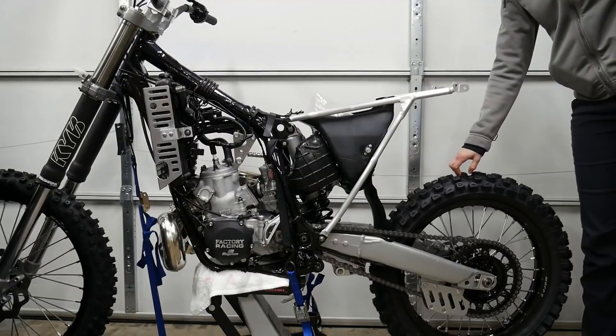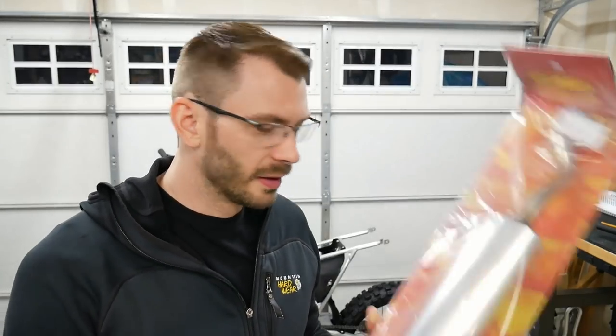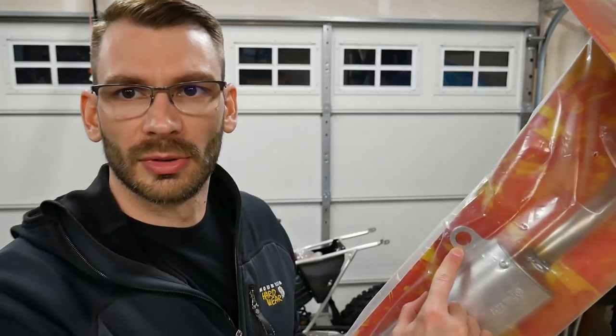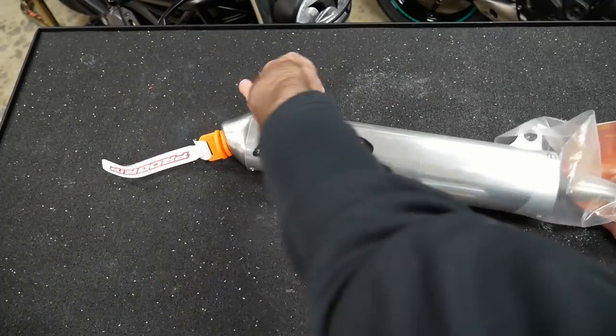So we went through all the gears and we confirmed that if the clutch had oil, it probably would have been a lot smoother. So next we're gonna put on the muffler, or the spark arrestor and stinger, sometimes it's called. The one thing we have to do before we can do that is put some rubber grommets in these aluminum holes here. So I'm going to take over to the bench and we're going to do that and get this all set up.